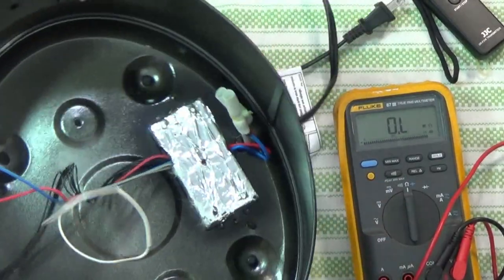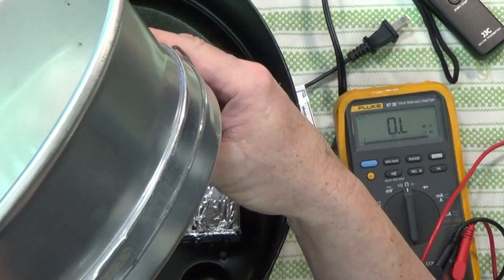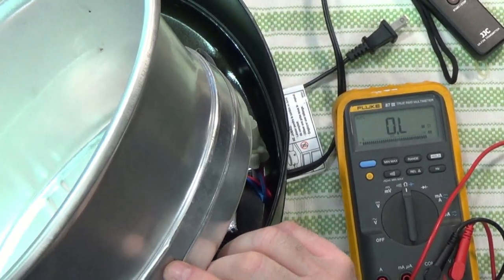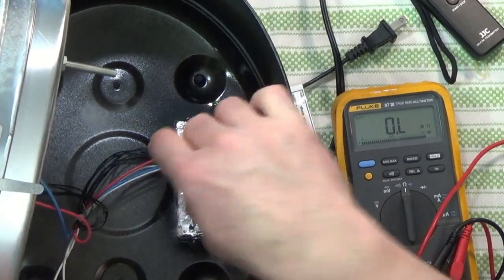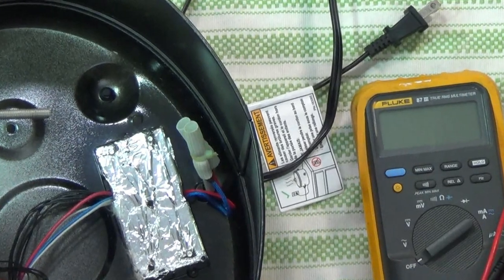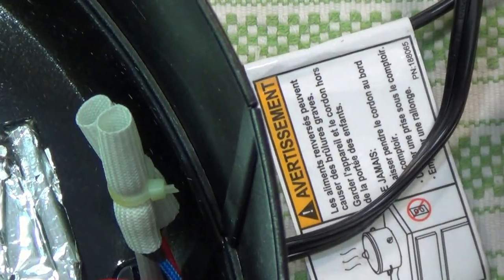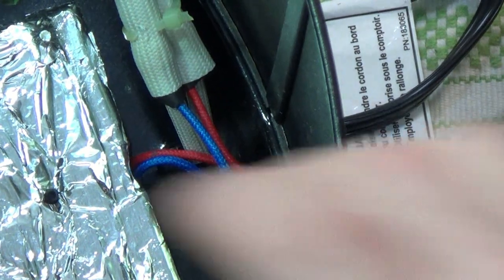What else do we have here? Let's look for other places. I'm still holding out for the possibility, since this is completely powered off, that the issue is thermal fuse related. I'm trying not to totally disassemble this thing if I can avoid it. The next thing I want to look at — I'm hunting for fuses — the symptom is no power at all. I'm going to open up these bundles down here, because that's the kind of material they hide fuses in. We're also looking inside a crock-pot, so they would use heat-resistant material.